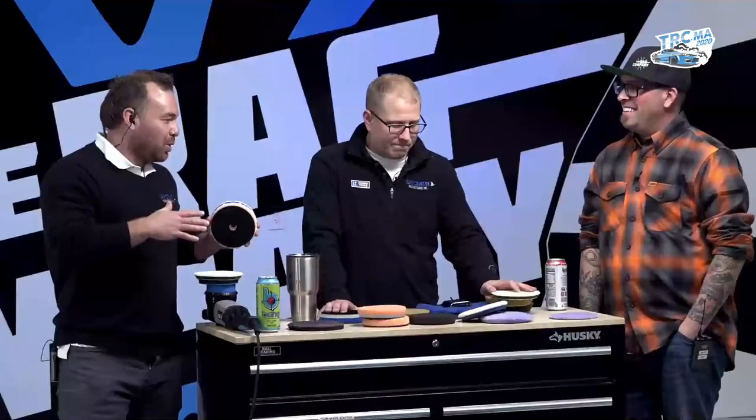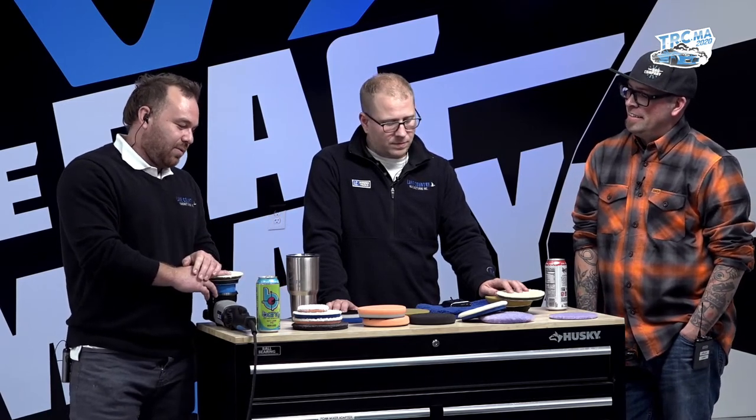Okay. Go ahead, Andrew. Sorry. These guys have been talking about their favorite pads. Well, my favorite pads are actually the microfiber, and I am a huge fan of just two-stepping it with a cutting pad and a finishing pad. So for whatever it's worth for the audience back at home, I love the foams, but I can finish everything out probably 90% of the time with both these, the cutting and the finishing pad. So I wanted to let everybody know that.